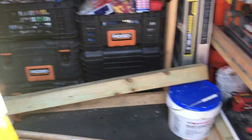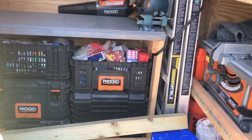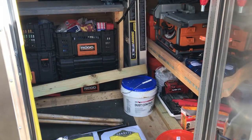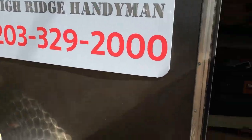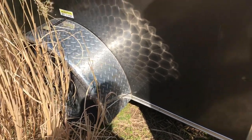When you're planning jobs with customers, give them a 30-minute heads up — either text them or call them, tell them you're on your way so there's no issues, no cars blocking. If there's stuff in the backyard that needs to be moved before you get there, make sure it's done because you'll waste a lot of time. Before we leave, we're going to check all the lights, blinkers, hazards — make sure the connection is done right. It's always a good idea to check the tire pressure too, especially if your trailer's been sitting all season.